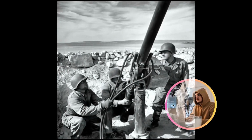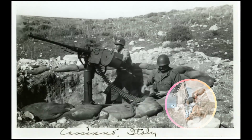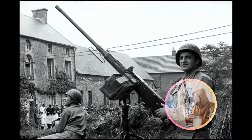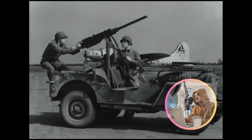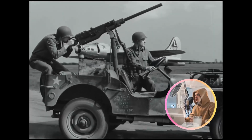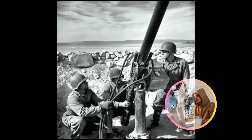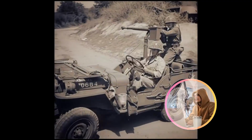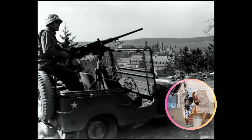Beyond this initial design insight, the subsequent critical challenge involved effectively managing the weapon's recoil. The formidable M2 machine gun unleashes an estimated 2,800 foot-pounds of recoil energy with each discharge. Under the conventional M31C pedestal mount, this entire force was directly transferred to the Jeep's chassis, which, due to its inflexible connection, then channeled the energy back into the weapon itself, establishing a detrimental feedback loop.